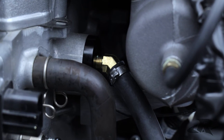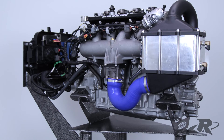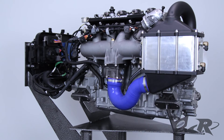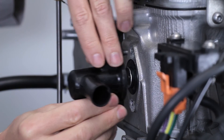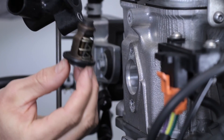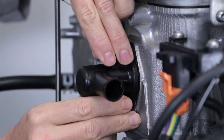Installing the engine block water fitting, which injects water into the rear portion of the cylinder block, allows the engine to run at optimum operating temperatures and helps prevent this type of damage. Another benefit of this cooling kit is that it retains the use of the stock thermostat, which allows the engine to properly come up to optimum operating temperatures in colder conditions.